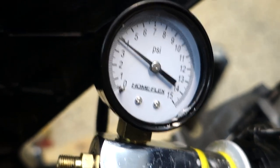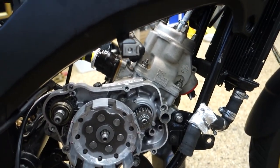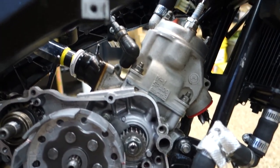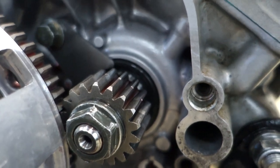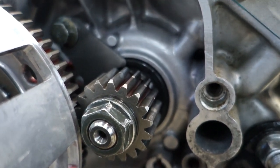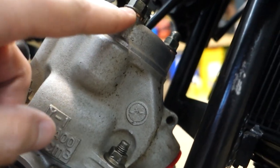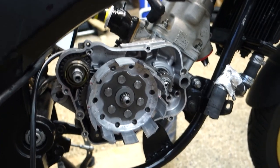After about five minutes we're at about 4 psi. I've read that you can lose as much as 1 psi over those five minutes and it's still within the range of acceptable loss. I don't hear any other leaks coming from the engine. We checked both side seals — I actually replaced the other one, this one isn't hissing, I sprayed it with some water and there are no bubbles. Nothing around any of the cylinder bolts or the head bolts. So I think we're good to go — put it back together and get back to tuning.